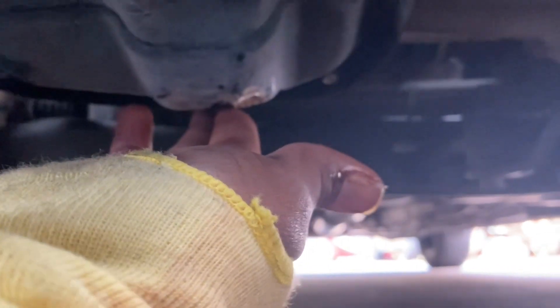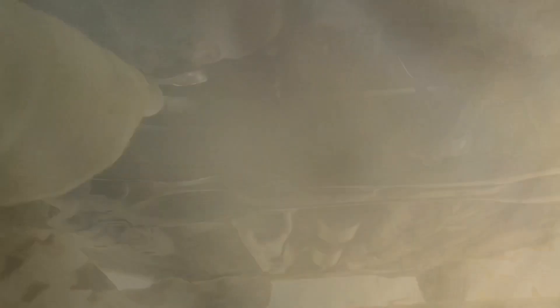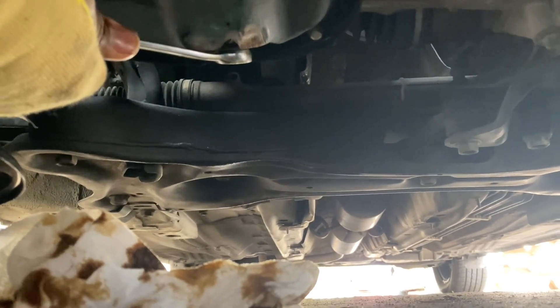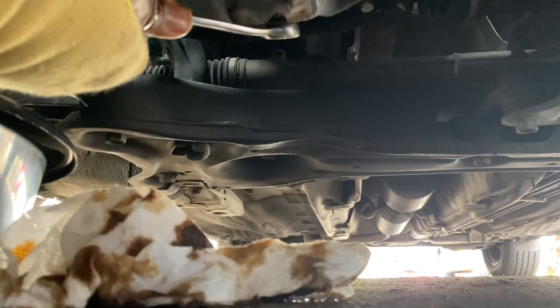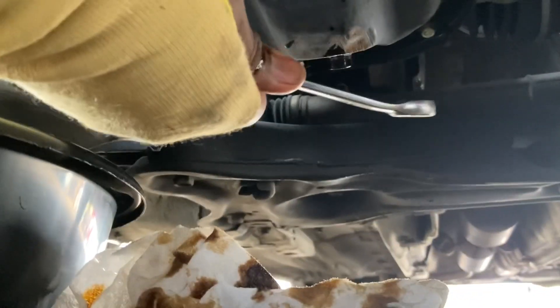And you just tighten it. Put the wrench back on there and give it some more torque — 14mm. You want to pull towards the driver's side wheel. You ain't gonna strain like you're bench-pressing to wrestle Hulk Hogan. Just a little bit past hand tight. Pull on it, but don't act like you're getting ready to go fight somebody. That's how you mess up stuff.